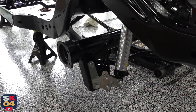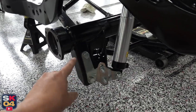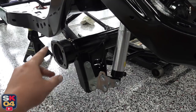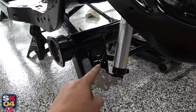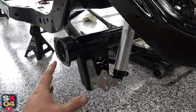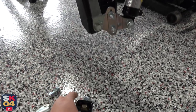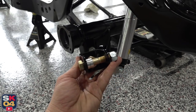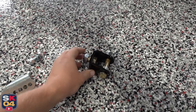I finally have a solution for mounting the rear coilover. Like I said, this bracket setup from QA1 wouldn't work on the Quick Performance rear end that I have — it's just a little bit of a different mounting setup. I thought this portion might be similar to a G-body, but I tried some G-body lower mounts and the angles were just a little bit off. So I called Quick Performance and we went over some ideas, and the solution was this — very simple yet very effective. Let me take you to the other side of the car and show you what it's going to look like bolted up.